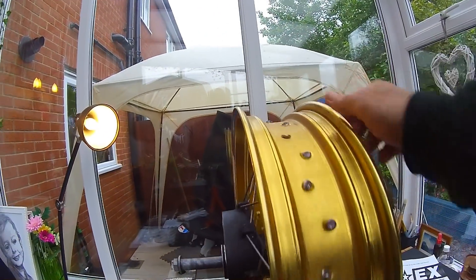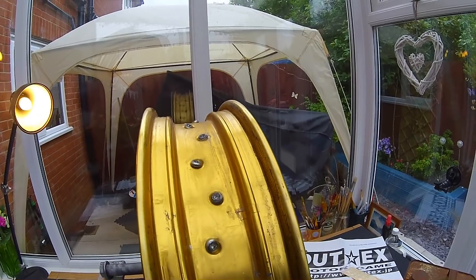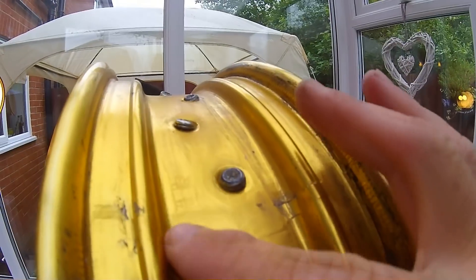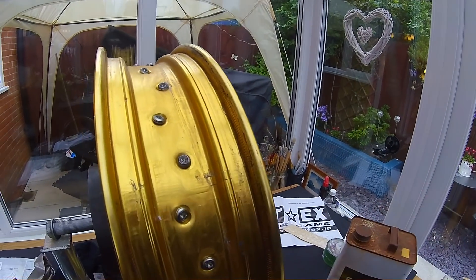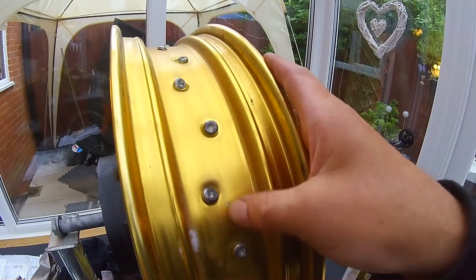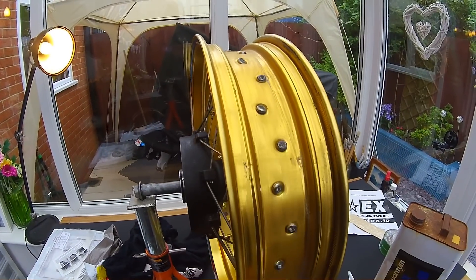The green tape goes all the way around, then the tape in the middle goes around, and we have two valves going in there. All being well it will inflate without a tube. One of the tricky parts is the join where the wheel is bonded — there's a tiny lip, so I'll put a bit of sandpaper on that to smooth it off. Get it absolutely spotless, then brake cleaner — jobs are good.